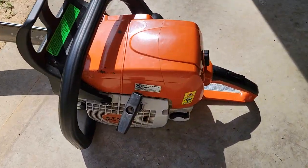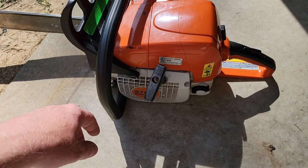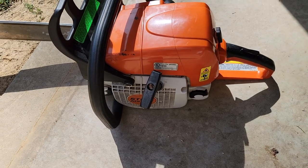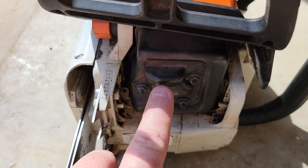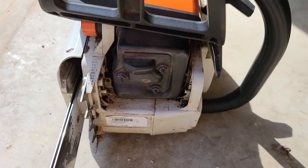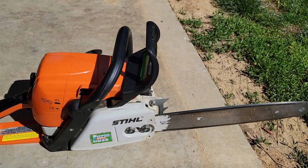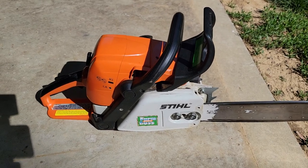I fired it up after doing this and it started on the first pull. The last time I was using it, I must've pulled on it 50 times before it finally started. So if your chainsaw is getting hard to start, buy that service kit — that's going to fix the hard starting. Shoot a little carb cleaner in there when you've got it out. I am super impressed; I got my chainsaw back. Another thing: if it's not running right, you can get some buildup inside — take those bolts off and there's a screen in there, that's the spark arrestor. If it's bogging down and not running at full speed, take that apart and clean that screen; it gets coated with carbon. Thanks everybody for watching — please like and subscribe.